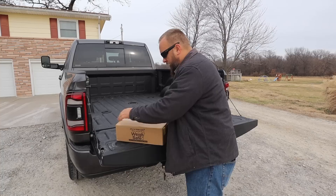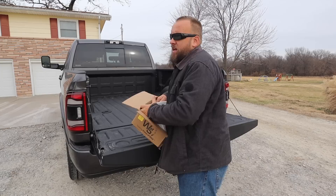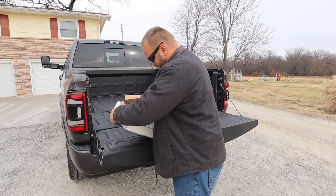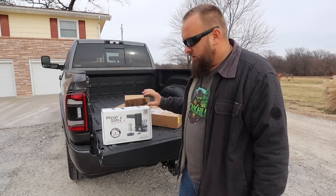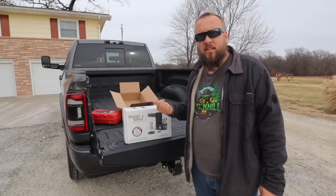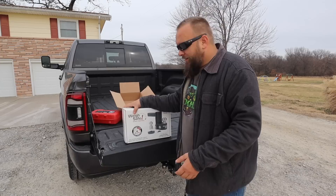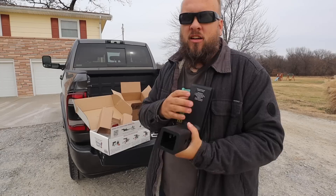Let's open these boxes up — I ordered both off of Amazon. If you're not familiar, they have a hydraulic gauge that shows you how much tongue weight you have. This is the one for the bumper pull, and the nice thing is these aren't just for testing — you can use them all the time. The hitch I have on now for my bumper pull trailers is one of those B&W reversible hitches, but it turns out it doesn't have the tow capacity I need, so I've got an expensive hitch that isn't even rated for the job.